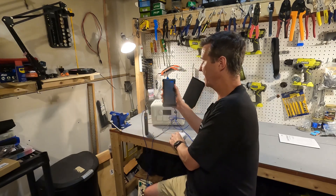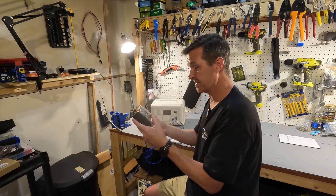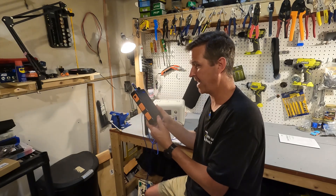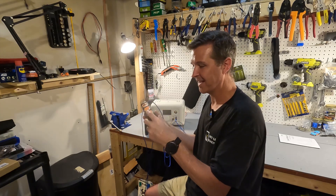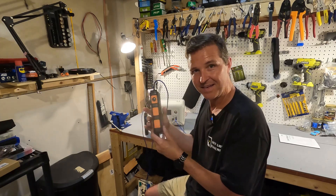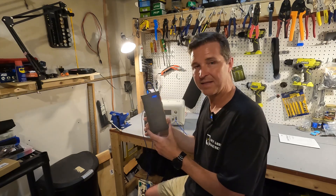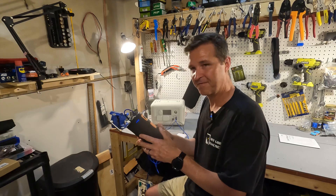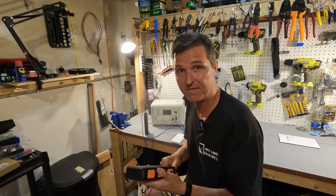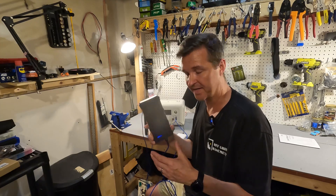I've got three different varieties. I've got this big massive one which is from Good Ah and it is 45,800 milliamps of capacity. It also has a small solar panel, a crank, so there's multiple ways of charging it, and it actually has the cords built right in. This thing is actually pretty nice and it has a couple of lights, so it's full featured. But is it really 45,800 milliamps? That is at 3.7 volts, so what that equates to is 169 watt hours.